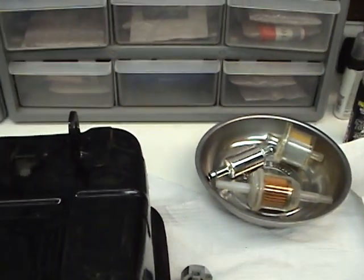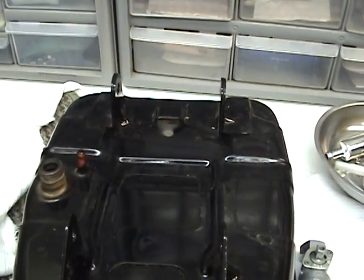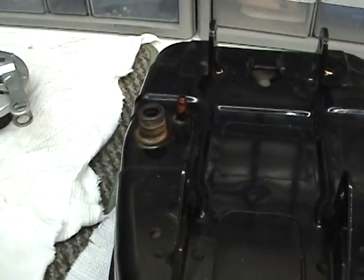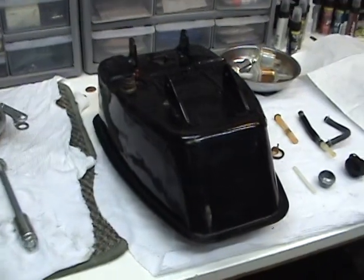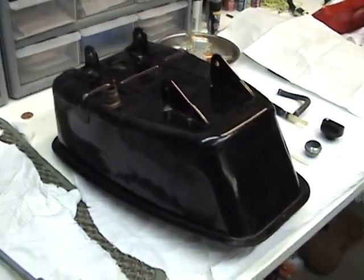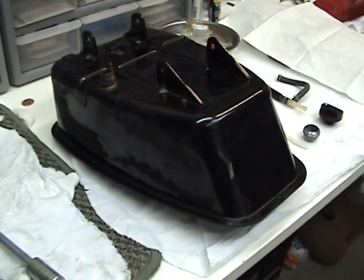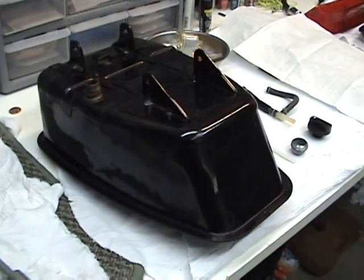Because you will know — and you don't even know if the new tank has anything in it. Now, to clean out the tanks, the first rule is you never use water around these tanks. They are specially lined on the inside, and if you use water to shake them out and clean them, it will rust on the inside.